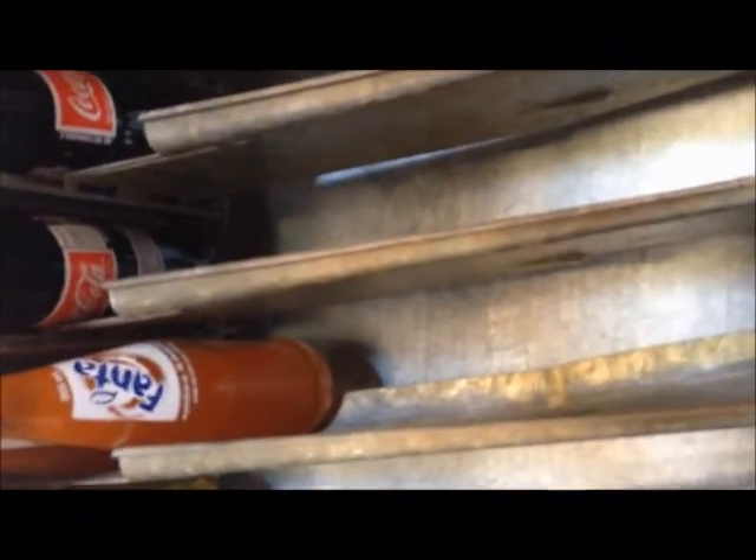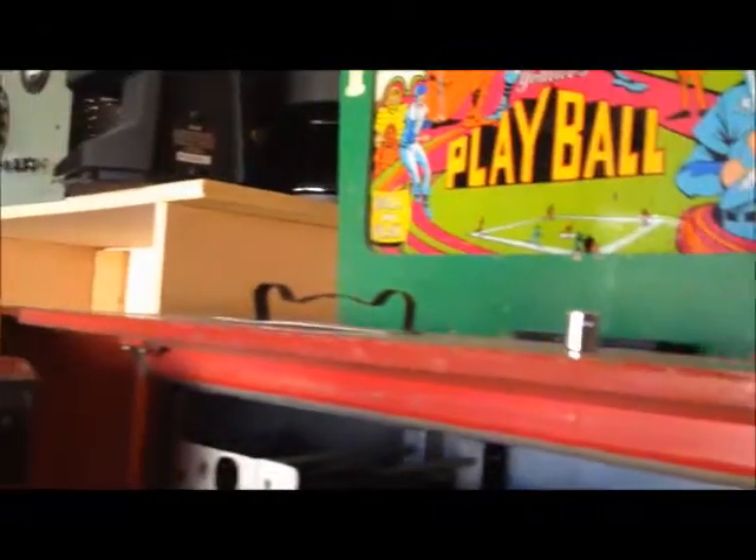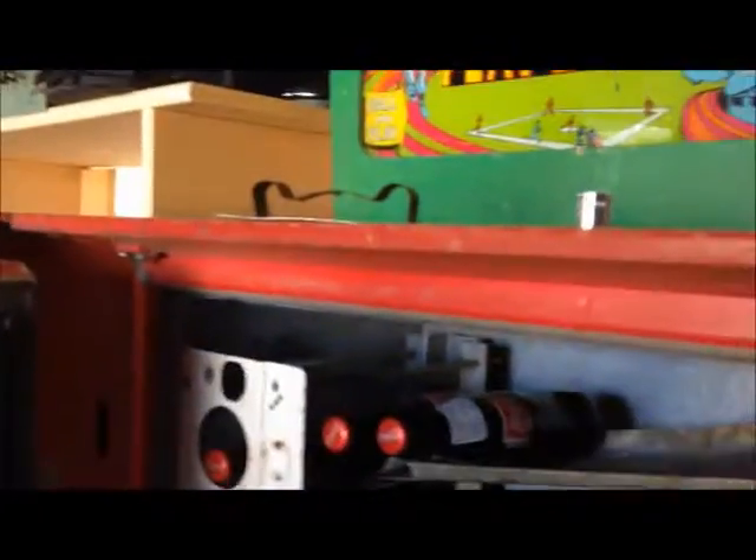Left is a screwdriver turn — there's a little screwdriver nib in the center. You turn that to the left and it will be less cool. You don't really want it all the way over; you might want to go around a little less than halfway, because your cokes will start icing up. And if they freeze, they'll pop in there and you'll have to clean up all the spillage and broken glass.